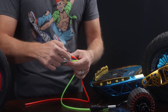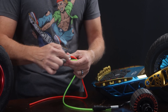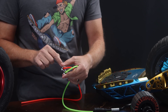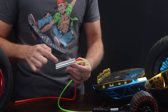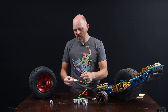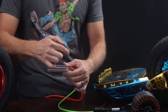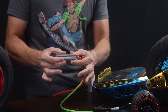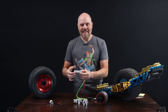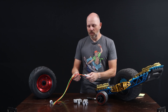The sleeve allows cooling water or coolant to flow through in a circular manner to maximize the amount of surface area inside the sleeve. There's not just a simple in-and-out hollow path — there's an actual water flow path through the sleeve to maximize heat transfer between the axle itself and the cooling fluid.